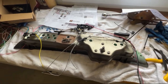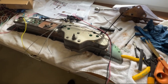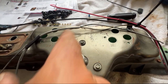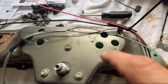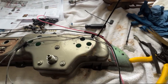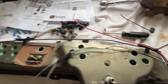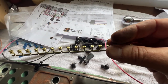Alright, I started getting into the wiring on the instrument cluster. They don't terminate a lot of wires, so I'm working on the gray wire ground — you put it together in a splice right here, then heat shrink it together. It's all crimped. These are all terminated at the dash lights. The wiring harness is very nice, but just like any wiring harness, they don't take the responsibility of terminating things — it's too much of a risk for them to be off a little bit. So I'm gonna have to wire all these bulb units. All these little clips ought to be fun — wish me luck.